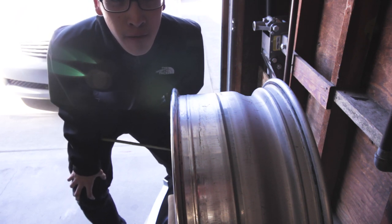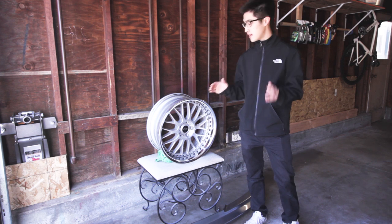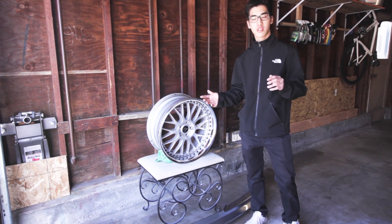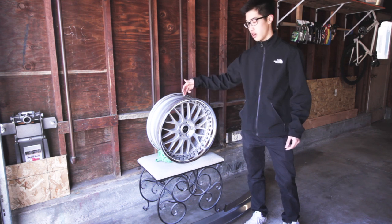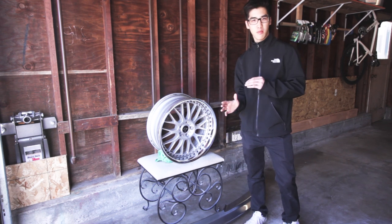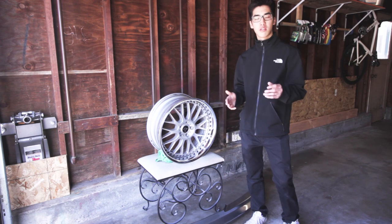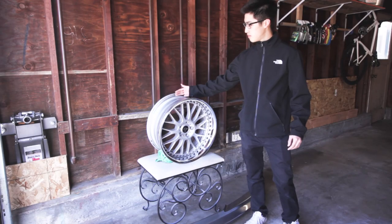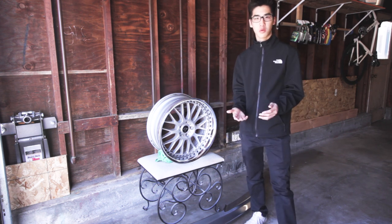My fronts on my car right now are four inches. Since I want a ten and a half wheel and this is an eight and a half, I'd have to add about two inches of lip, making it a five and a half inch lip. The difference between the front and rear lips would be an inch and a half, which is more than I'd like — I'd prefer an inch or half an inch — but there's not much you can do. The same approach goes for measuring the barrels: measure from the bead to where the silicone is. I hope this helped whether you're relipping your wheels or trying to get the right fitment. Thank you for watching and stay tuned for the next video.